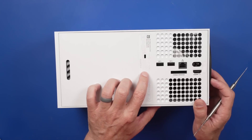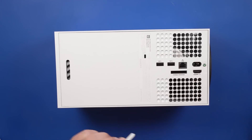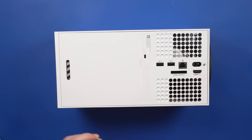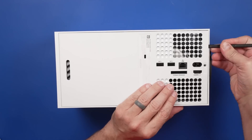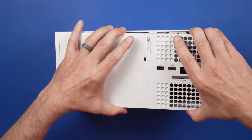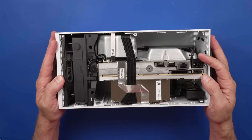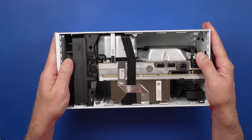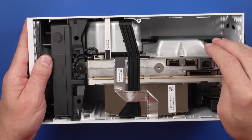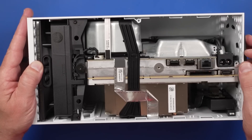Just like the previous model, there's a screw right here — I've already removed that for the sake of keeping this video quick. We take off this sticker, and there's one green screw right here. Then we just pry up this back plate, just like on the previous model of Xbox Series X. When we get inside, we can see it looks pretty much exactly the same, it's just without the disk drive. Looking down in there, there's no grooves for the disk drive to sit into, so this case was definitely meant for this Xbox that doesn't have the disk drive.